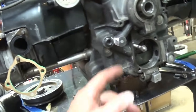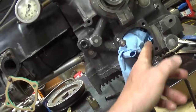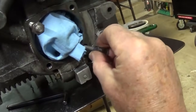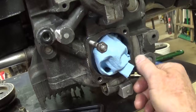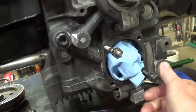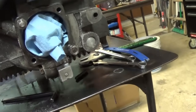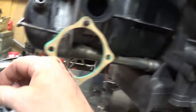This is all magnesium dust I'm getting off - you can light that with a torch fairly easily. I need a fresh paper towel to kind of hide that and keep the magnesium dust out. There's just nothing at the beginning of those threads - look how loose that is, it's horrible. I've got to get in deep before I get some meat. I'm going to use that thicker gasket, and I just want to plug up these holes with my studs.